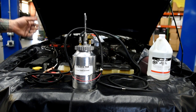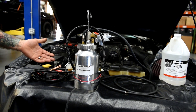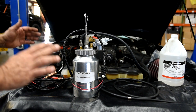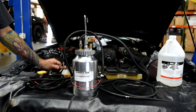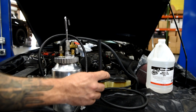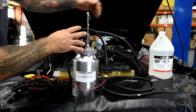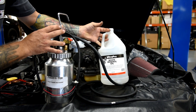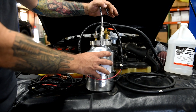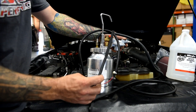Let's give you an overview of the smoke machine. I've used many different smoke machines and many different configurations, but this one is by far the best one I've used — it's very inexpensive, simple, and it just works well. You have your battery leads which you hook to the car, and your tube that you apply to whichever system you're diagnosing. You fill this container up with white mineral oil — just a small amount over the heating coils — and that will produce smoke. When you pressurize the container, it will push smoke into whichever system you're diagnosing.